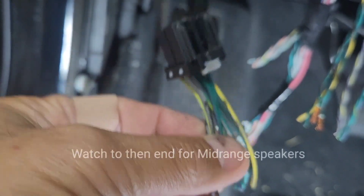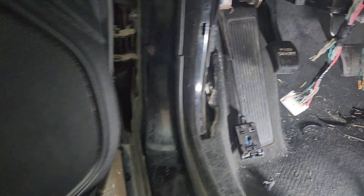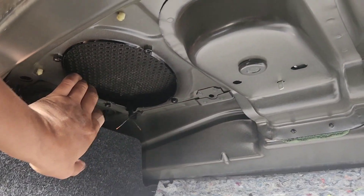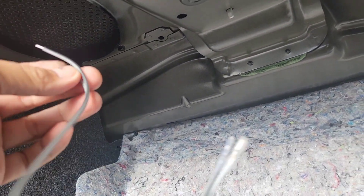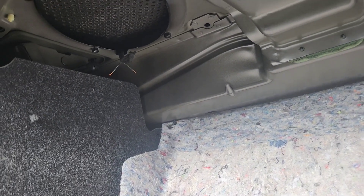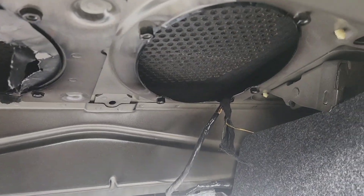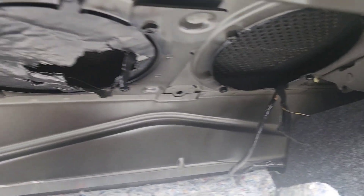This LOC will feed the four-channel amp, and this wire goes straight to the speakers via the nine-wire conductor. He told me all the speakers are missing — he didn't have the money to have me install them. I'm gonna run the wire from here. For the left rear, dark green/tan is positive. For the right rear, dark green/brown is positive, and the other is negative.